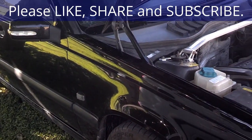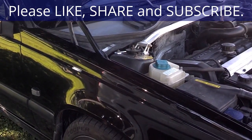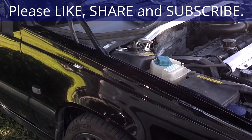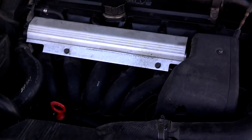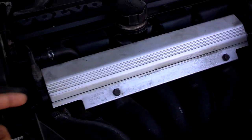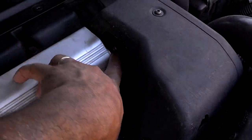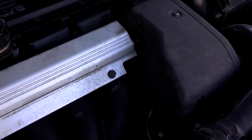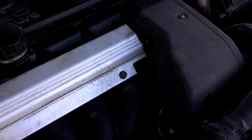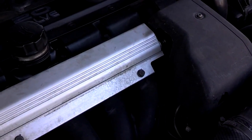Of course, you want your vehicle to be sitting on a flat level surface when you're doing all this, so that water could be at the lowest point and your fuel pump could pick it all up and get it out of your system. The next thing I would do is disconnect my fuel line at the fuel rail that has your fuel injectors, or I would open up the end of the fuel rail. I would activate my fuel pump, push the fuel through there a gallon or half gallon at a time until I was sure I had no more moisture or water coming out.